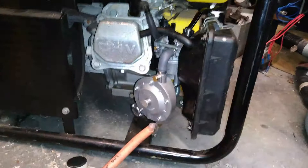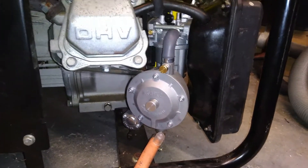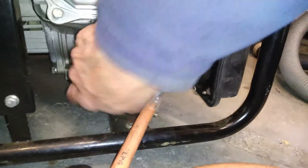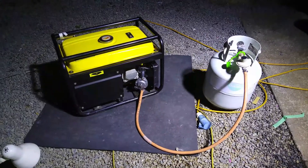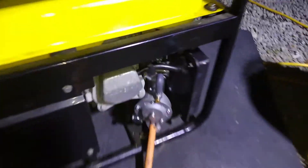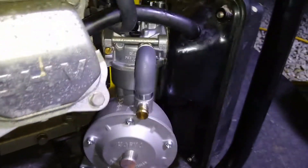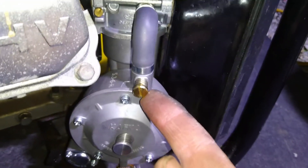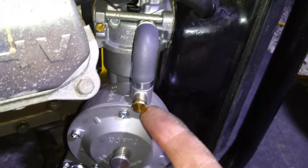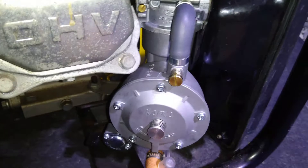Okay people, the new carburetor's mounted. I'll go try it on gas and see what happens. Good news — it goes! I did have to play around with the mixture screw a little bit because it was hunting on idle, but I just had to wind it out a bit and richen up the mixture for the LPG and it came right. I haven't tried it on petrol, but it goes well on LPG.